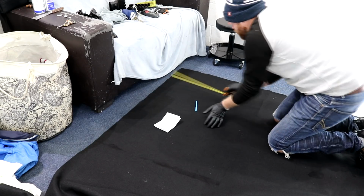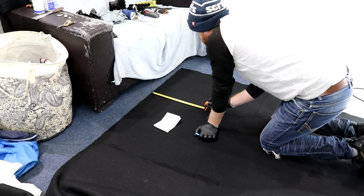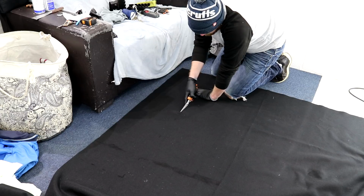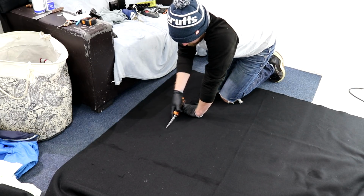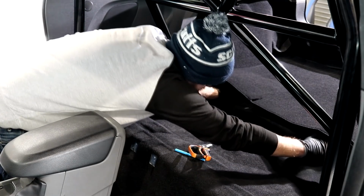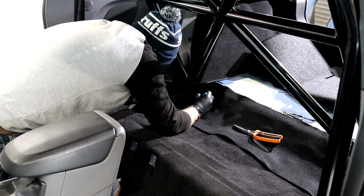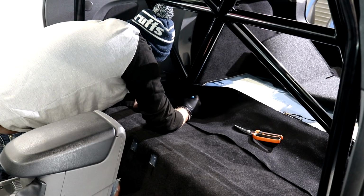The only dodgy area on the interior now that the carpet and interior panels have been fitted is the exposed centre section of the chassis where the rear boot carpet doesn't quite meet the interior cabin carpet. I bought myself some black fabric from eBay and took some measurements before cutting a similar size section out. I quite literally fixed the cutout fabric section in place and drew a template around the base of the roll cage. I then cut the fabric as I went, and before I knew it, the fabric was sitting well enough to cover the exposed sections of the chassis. It isn't 100% perfect, but it's 10 times better than before.